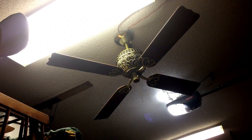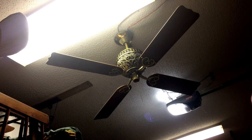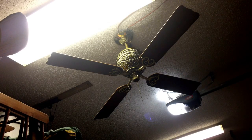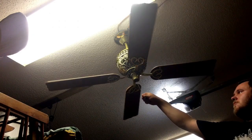Alright YouTube watchers, this is my Hunter 1886. I just replaced the capacitor in this one. The speed capacitor is good but I changed it out also — the run capacitor was dropped, should have been a five for a run and a five-plus capacitor for the speeds. The original one had a four for a run. The drop was on my third speed and the other one was fine, so I kept them low. Either way, the fan is off on low — so high, medium, low.